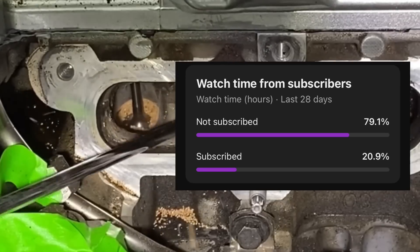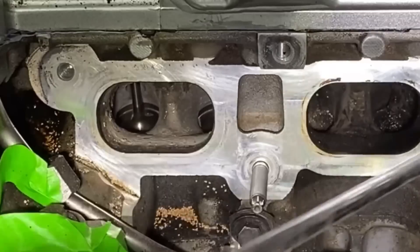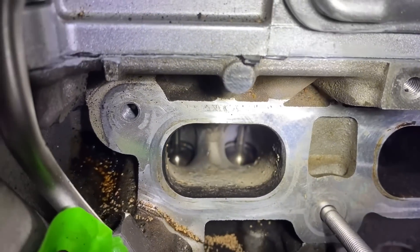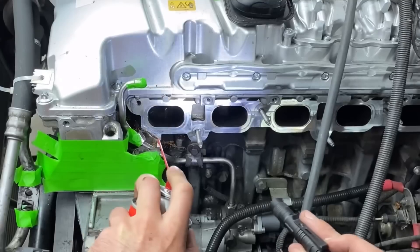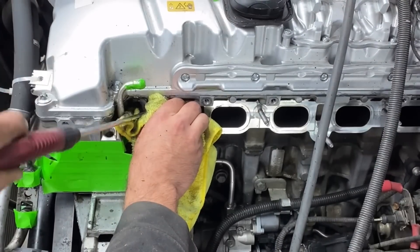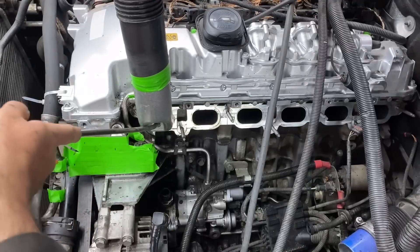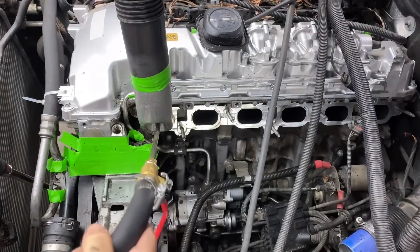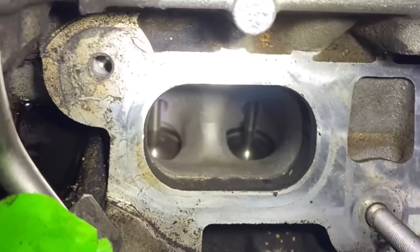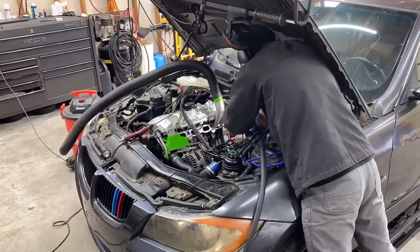Did you know that 80% of my viewers are not subscribed to the channel? If you enjoy this video and want to help me afford some new microphones, be sure to hit that subscribe button. Don't mind the walnut shell everywhere from when I had that shop vac reversed — but check out cylinder number one. I am thoroughly impressed with how well this media blaster works. I'm spraying down the outside of the port with some brake cleaner and hitting it with a wire brush to get some of the big stuff off. I bring the wand all the way back, do big circles to really spray the outside walls, spray it out with compressed air, and look at that finished result — that cylinder is mint. Now we just rinse and repeat for the other five cylinders.